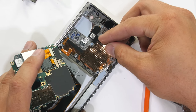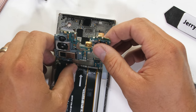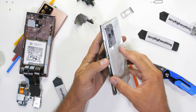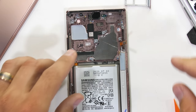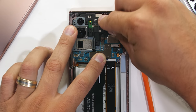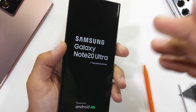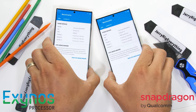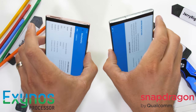Now that I've inserted the copper cooling system into the Qualcomm phone, I can put the graphite cooling system in with the Exynos processor, since the layout for the cooling is exactly the same across both models — they have the same size and footprint. Of course, now they don't have the factory seal anymore with the frame of the phone, so it's not an absolutely pristine example, but it's still worth taking a look at. I've got everything put back into place, connected like little Legos and screwed down, so we're ready to start the benchmark test over again. The international Exynos phone is on the left and now has the graphite cooling system installed, and the US version is on the right with its Qualcomm and new copper cooling system installed.